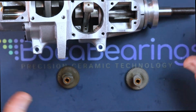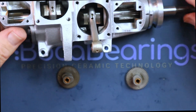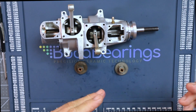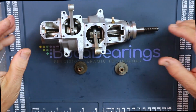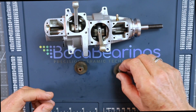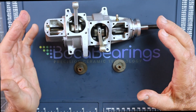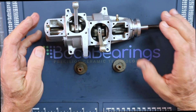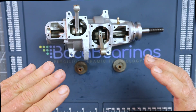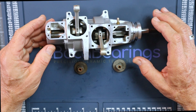After all that explanation and show-and-tell, I'm going to zoom out, reassemble these cam gears into their housing, get everything ready, time the engine as I described using the same gear that was in there, and then put the cylinder heads on. I'm not going to show all of that because it'll take time you don't need to watch. I'll come back once I have the heads on and a preliminary valve lash setting done.